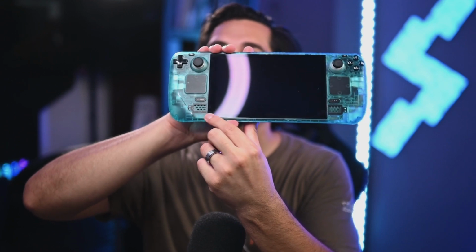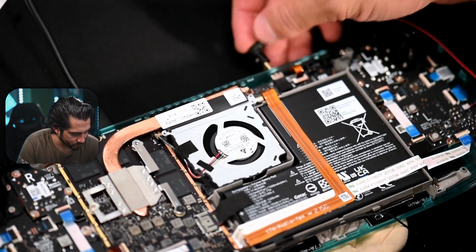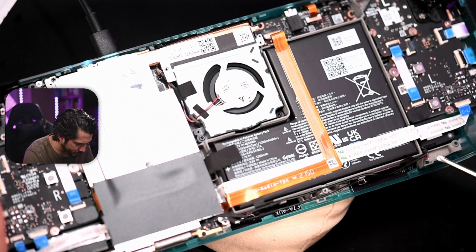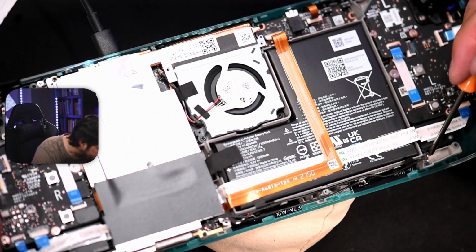And sure enough, I found that this speaker right here on the left side, when you're looking at it, was hissing and crackling. I plugged in my headphones. Headphones were perfectly fine. I connected my Bluetooth earbuds. Those are totally fine. So I deduced that it definitely was a speaker issue, not really an audio issue. Maybe the speakers are damaged or the wires are damaged.